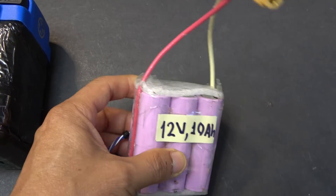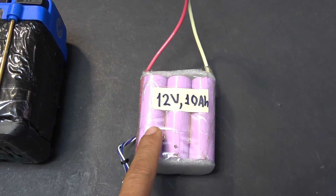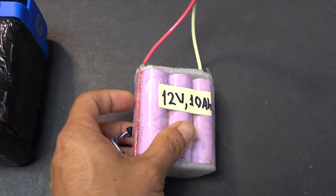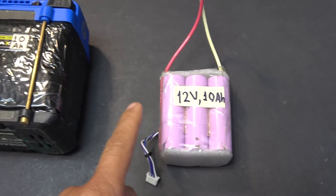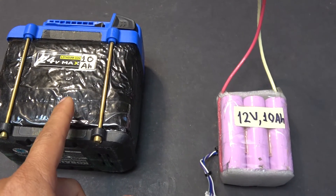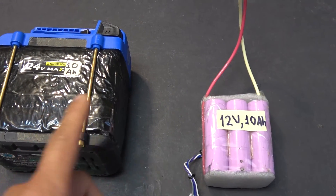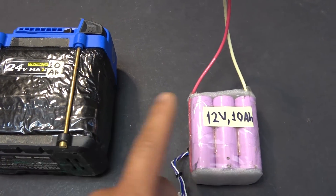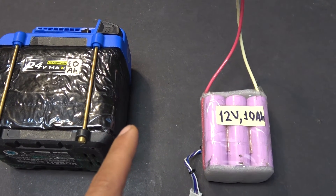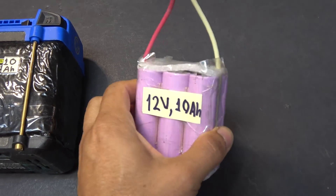This pack is made of six Tesla Model 3 2170 cells. Each cell is capable of 10 amp continuous discharge — two in parallel gives 20 amp continuous discharge, which is much lower than the Cobalt pack's roughly 100 amp continuous. But because they're connected in series, and most importantly my bike only requires 20 amp continuous discharge, this pack is perfect for this application.